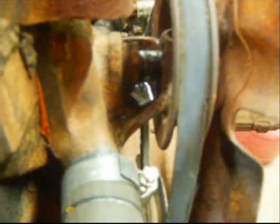I noticed the water pump is leaking a little bit. I think tomorrow I'm going to pull that off — there's a brass nut in there around that shaft, and I'm betting there's some packing behind that nut. I'm going to find out tomorrow. Either way, I know where I can get it, either a new one or a rebuilt one. So this is not going to slow us down much.